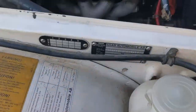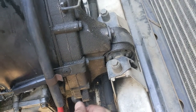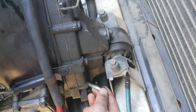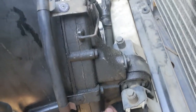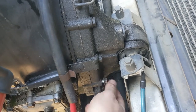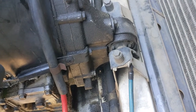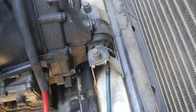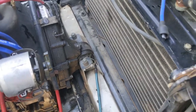This bolt comes out, get the ground cable out of the way, and stick the bolt right back where it came from so you don't lose it. This is the primary cover for the transmission — these bolts are a specific length. If you put in one too long or too short, you'll have a problem; you could end up causing damage to the transmission case. So just be aware of that. When you're done, tuck the battery cable out of the way so you don't crush it. We're done with this part.